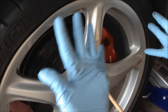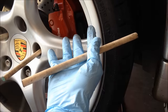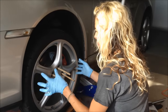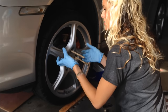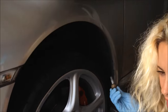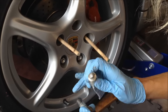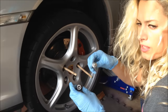Voila! As you can see, my gorgeous red caliper is in. I wanted to show you how I get this tire in by myself. A handy way is to buy some dowel rods, situate your tire, and kind of jimmy the dowel in there to place it and straighten out the wheel yourself — in case you don't have an extra pair of hands. I'm going to put a little anti-seize on this before it goes in, just a touch, and then I'll tighten all this stuff up.